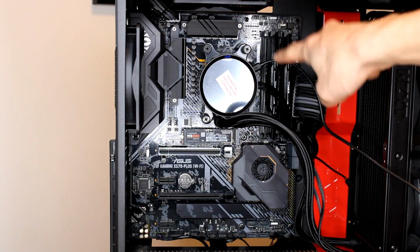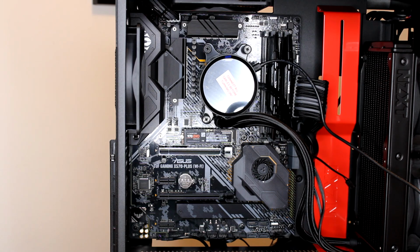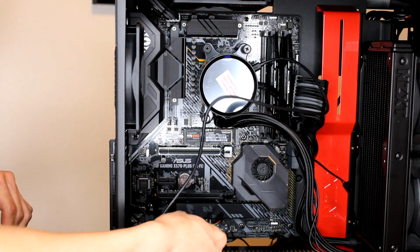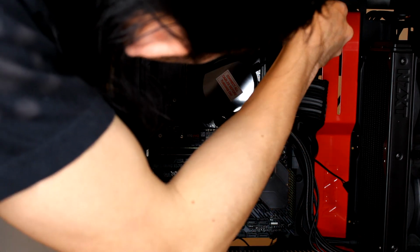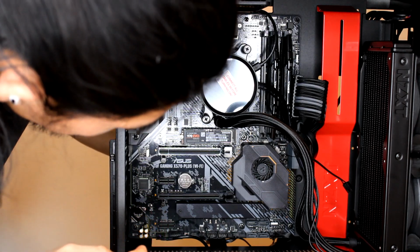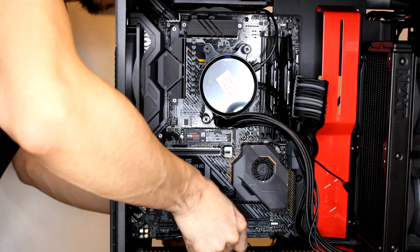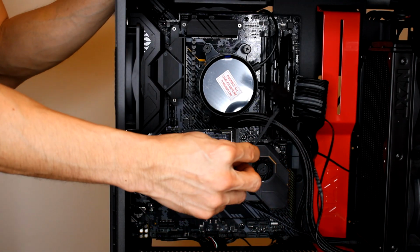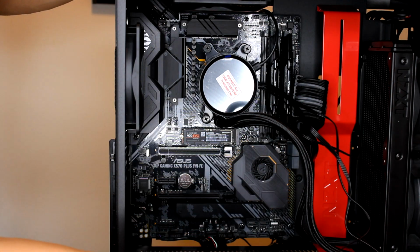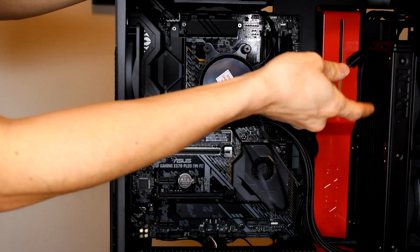So now we have all the cables plugged into our cooler. We're gonna try to cable some of it to our motherboard, including the fans. So this one's gonna be the USB, which is down here. So I'm gonna go ahead and route this up top like so. And we'll run it back up and plug it into one of our USBs. This is gonna plug into a SATA plug-in from my power supply, so I'm just going to run this in the back as well. This one's going to be for a fan splitter, so I'm going to run this in back because our fans are back there.